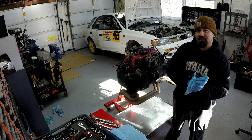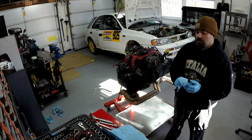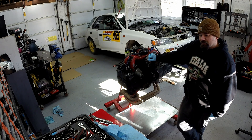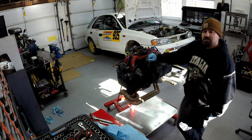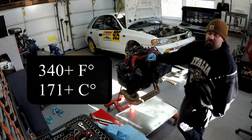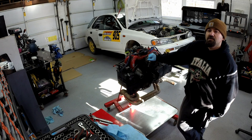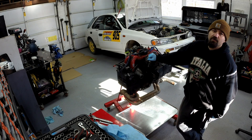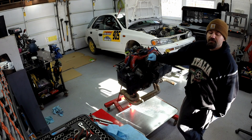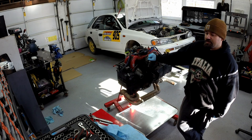Hi, I'm Brian. If you watched my last video, you know that at Sandblast Rally we had some mechanical issues towards the end of special stage 2. The car stalled and didn't want to turn over. We eventually got it started again but it wouldn't idle - you had to rev it. We finished the stage, but the oil temperature had shot through the roof at 340-plus degrees. At the end of the stage we started hearing knocking, made it a mile or two into transit towards service, and the car completely died. It wouldn't restart, and when I checked the oil there was metal flake in it. From the moment I saw that oil temperature during the stage, I suspected a rod bearing.